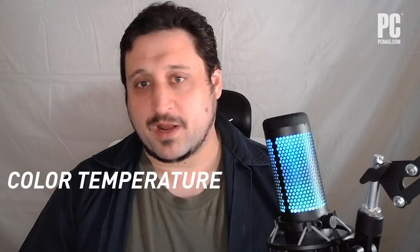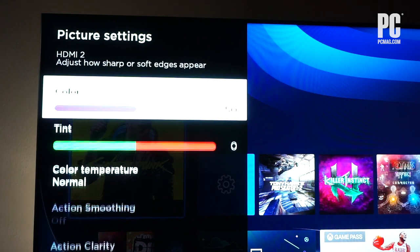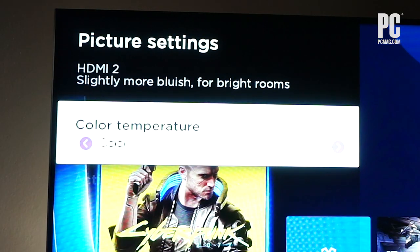The second tip is adjusting the color temperature of your TV. Now, if you're in movie or cinema mode, it should do this automatically, but it's always good to go into the menus and check. Go into your TV's color temperature mode — it might be called color temperature, it might be white balance, but it should just have a single word as a descriptor for the mode. Do not adjust settings with different points or different numbers, as those are for calibrations and a lot easier to get wrong.